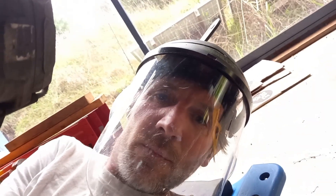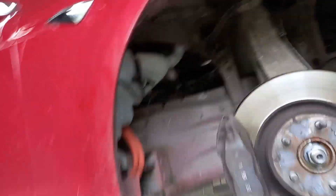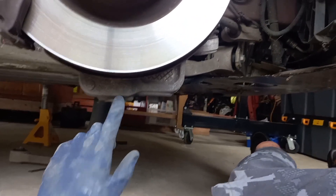Hello and welcome from the floor of my workshop where I am currently trying to get my Tesla past its safety inspection. We're at the front here. The car has failed — let's go on the outside actually — because the lower ball joint here is too loose and so it needs a new one.